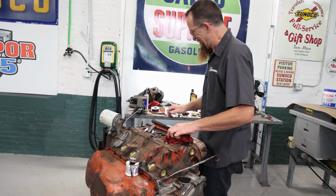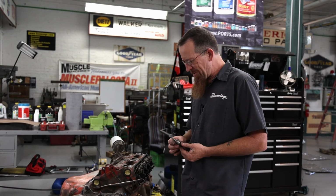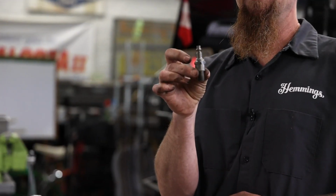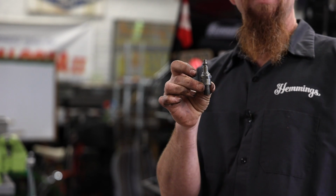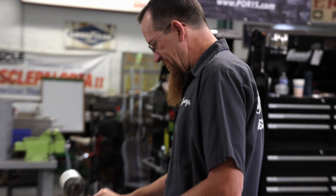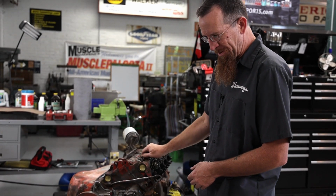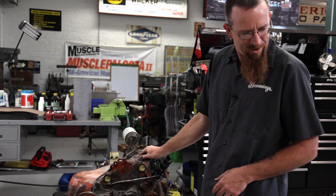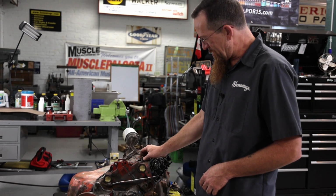Oh joy. So all the spark plugs are out, and what I've done is basically hollowed out an old spark plug, took the porcelain out and TIG welded an air fitting on. So now I'm going to pressurize the cylinder with shop air, and that's going to hopefully keep enough pressure on the valves so they don't drop out.